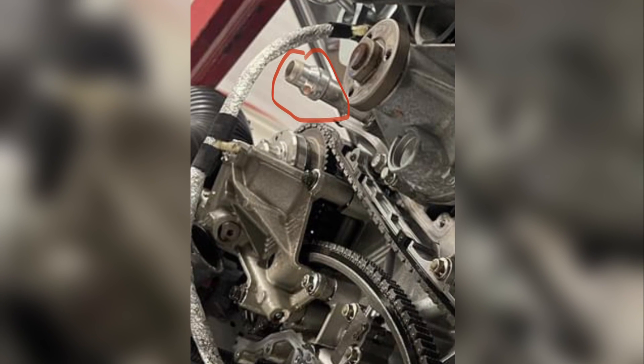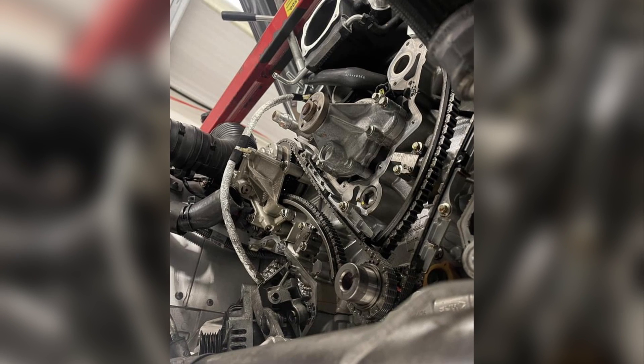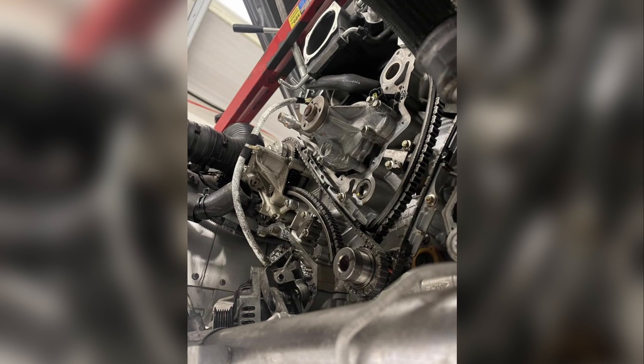The other reason I cringe is — if we zoom in on these pictures — you can actually see little dribbles of coolant that are just waiting, if disturbed, to drop down. They'll most likely compromise the sealant and get in between the front cover when it's being put back on the engine, risking the longevity of the fix. It's really difficult in this position to get the front cover on — you haven't got clear line of sight, you've got to jiggle it around. Whether it was oil leaking out of a gallery or a little bit of coolant waiting to drop, it's not a robust practice to fix the problem with the engine in situ.